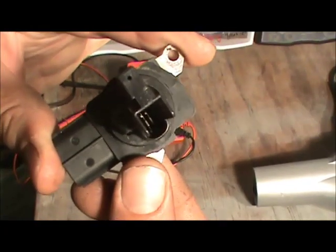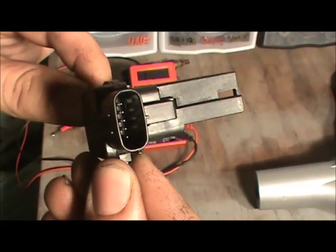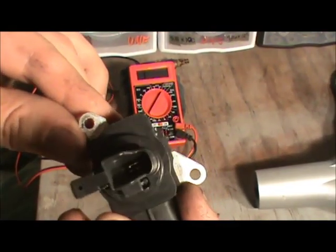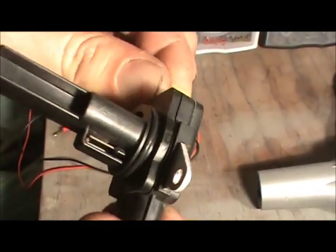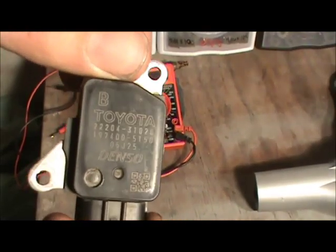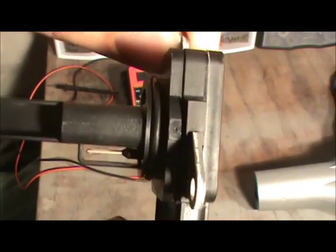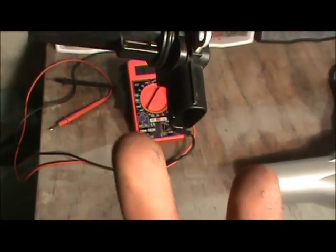Down there are the mass airflow sensor. Let's count the pins: one, two, three, four, five — five pins total. Three of those pins are for the mass airflow sensor, and two are for the intake air temperature sensor right there. This unit can be found on Subarus, Toyotas, and Nissans — it's a Denso unit and Denso makes it for all these different Japanese manufacturers. Those two wires go to the thermistor which is the intake air temperature sensor.